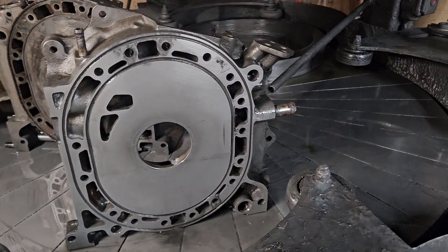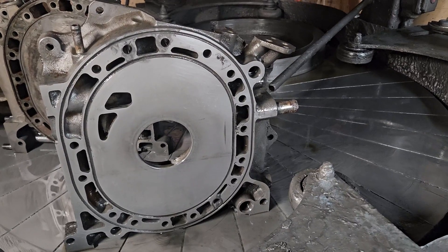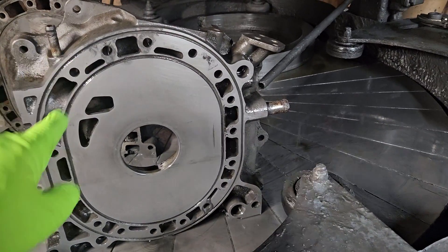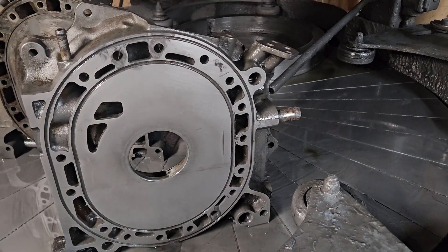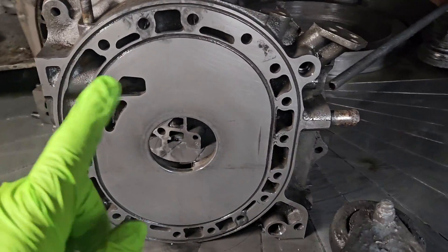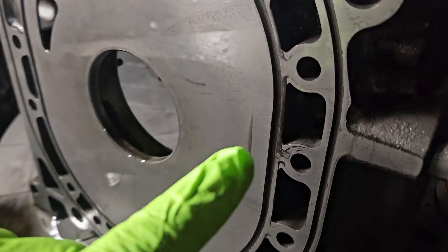But after doing this for 25 years, I don't see a big need to re-nitride. And what I do see is that avoidance of resurfacing can lead to problems. And this is the example I'm pointing out.